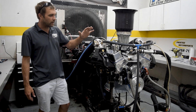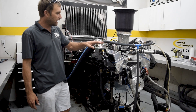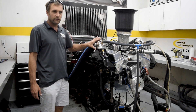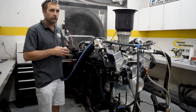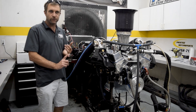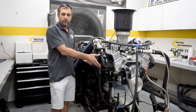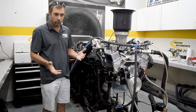Something we're focused on — we had already done a video and previously ran this, and when I saw the tailpipes I was a little concerned. When you get into marine exhaust, you're going to hear a lot of scuttlebutt about the motor sucking up water, or don't put too much camshaft — meaning too much duration or too much overlap. These manifolds, when you look them up, they say they support 400 or 450 horsepower.